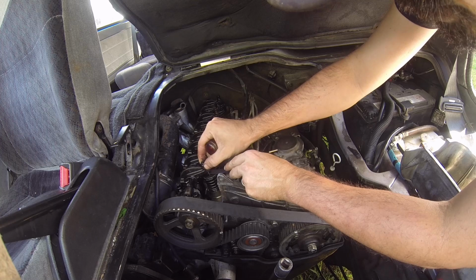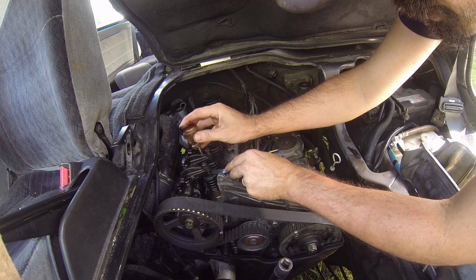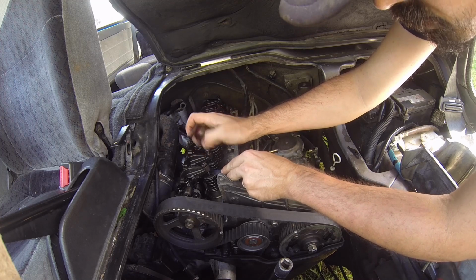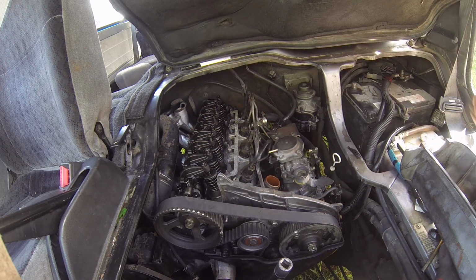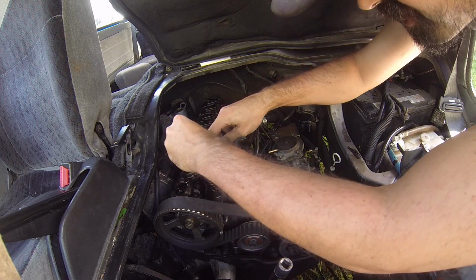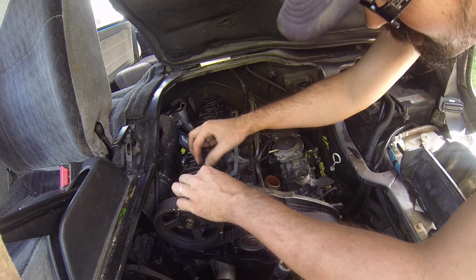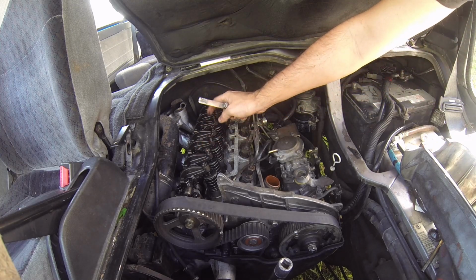You want to make sure you can't lift that, but that the feeler gauge is nice and smooth in there. Just tight but not dragging. That's a little bit too much there, perfect there. So put your spanner on, lock that in place, and then tighten that lock nut. And then we continue on with the, so we do the first, the second, the fourth and the fifth.